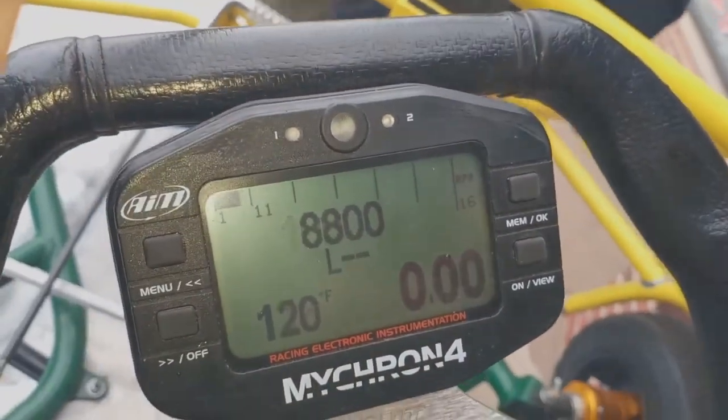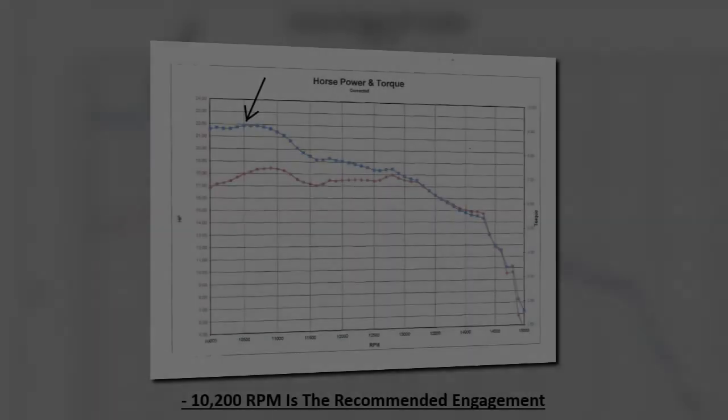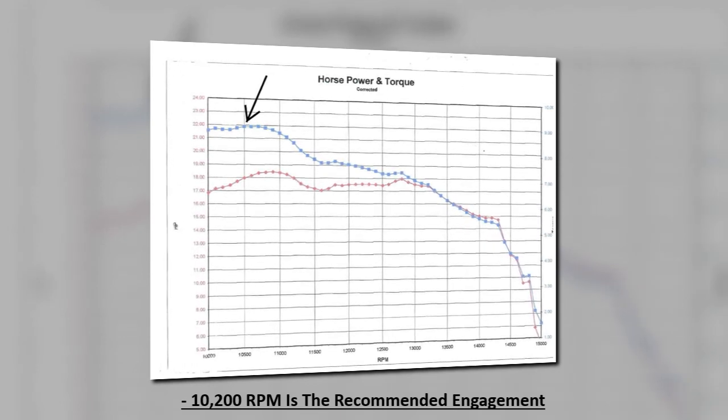The RPM reading should stabilize within a second or two, and you can let off the throttle. At this stage, all you want to do is get within a couple hundred RPM of where you want to be. Shut the engine off, make the necessary adjustments, try again.